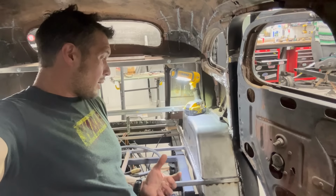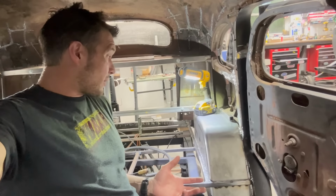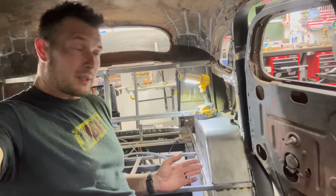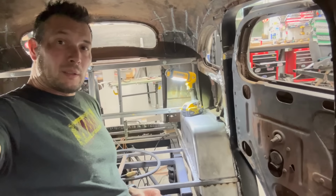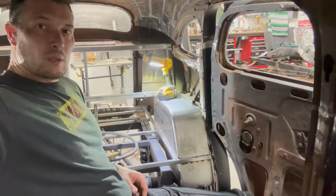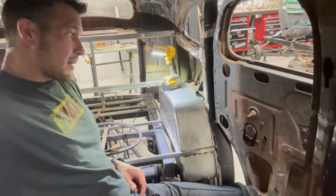So I'm gonna see if I can do the passenger side in like tonight. Now that I know what I'm doing, I will kind of cut the fender down to this shape. I will get the inside of it welded in there. I will weld it onto the bracket or the skeleton for the trunk frame here. So, looks pretty good as far as I'm concerned.